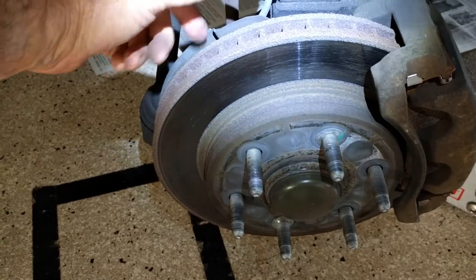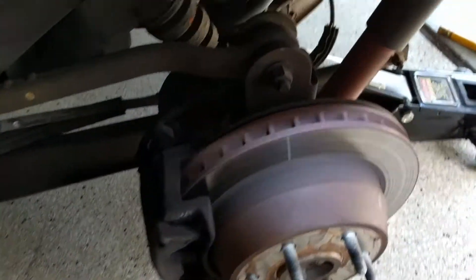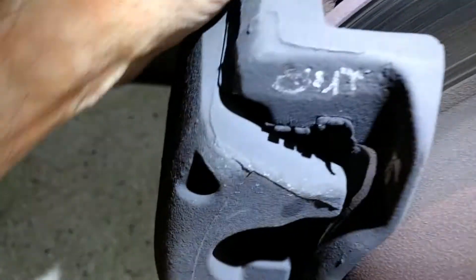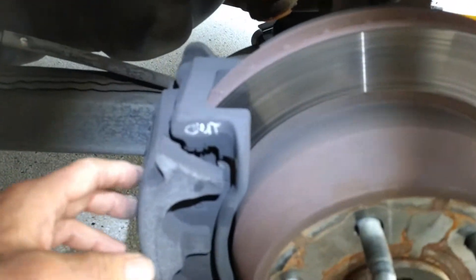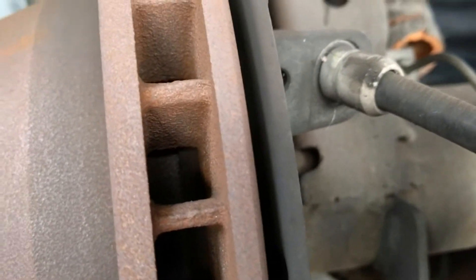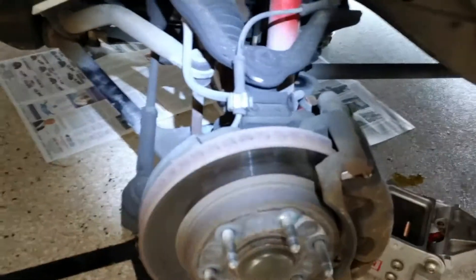Just to show you — let's go to the back. Here's the brake fluid connection, your rotor, your caliper, your pads in there, your caliper mounting bracket. But there's no wire back here. That's the parking brake cable right there. So again: brake fluid, parking brake cable — no wire back here. So this truck does not have rear ABS; it has front ABS only. I just wanted to show you that.